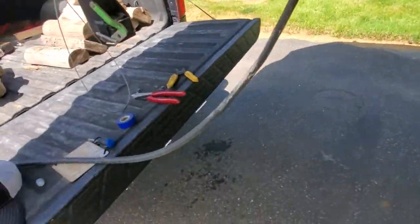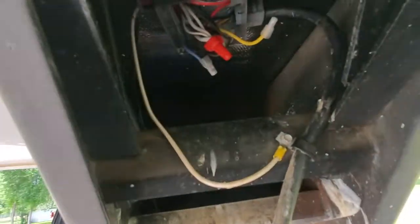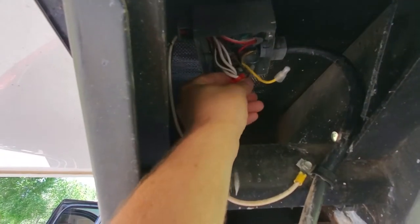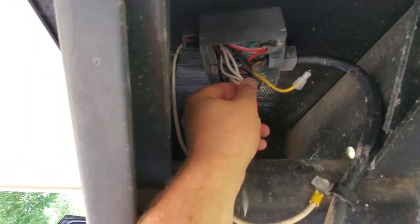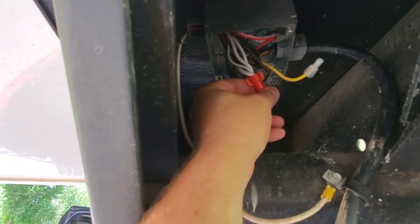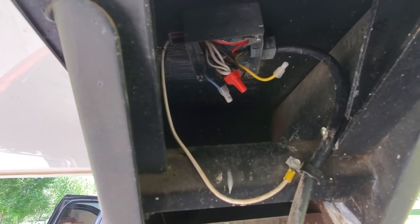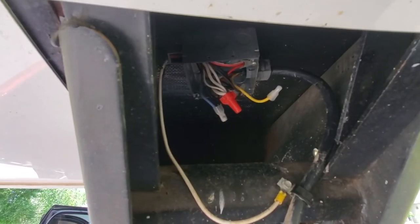Then lastly, you can see the cord going up into the trailer right here at the hitch. There's a J-box, and these are all crimped on here. What I found was that this white wire, which I believe is the ground wire for this system, had actually come out of the crimp. So I just redid the wire nut and I'm going to tape that up. That ended up being the problem right there — a loose connection in this J-box under the hitch. So hopefully that helps you guys.